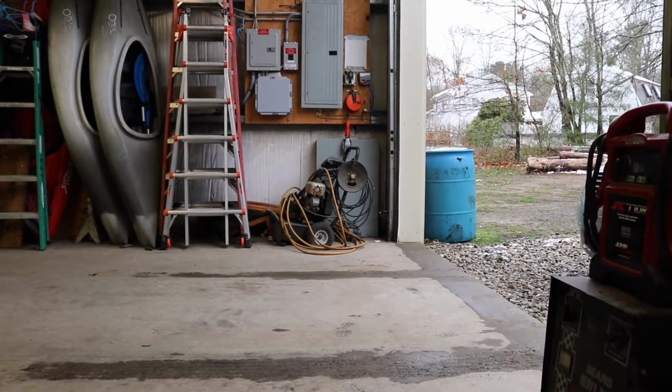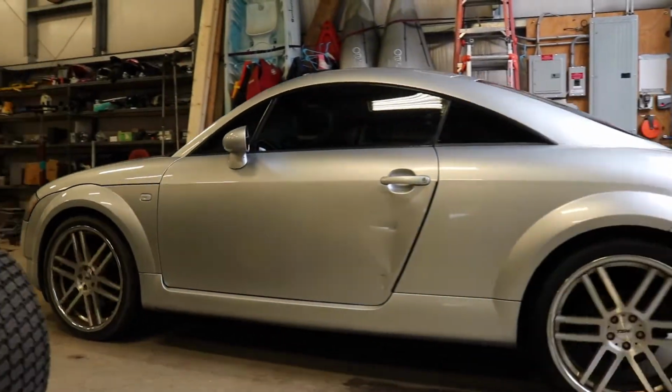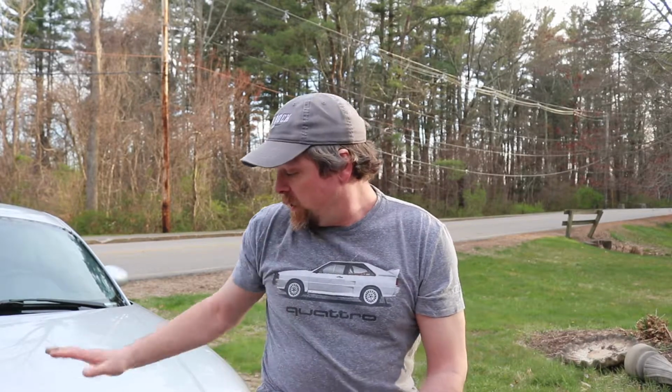Now we can get into the process of changing your oil. The first thing that you're going to have to do is lift the vehicle off the ground if it's not a big truck that you can slide yourself under without lifting it. We've got a car that needs to be lifted, and you can do that with either a jack or with a car lift, and you have to find the specific spots on the car where you'll lift it from safely without doing damage to the body.